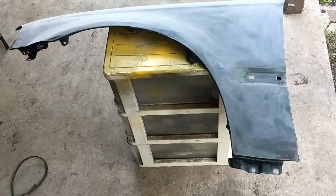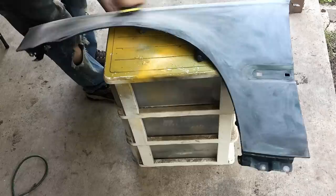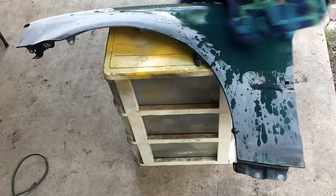You're gonna want one of these little foam blocks — they sell them at AutoZone really cheap. Put the sandpaper on it; that'll help you get into the curved areas because it's more flexible. After sanding, go ahead and sprinkle some of that wax and grease remover, let it soak in, and then wipe it down. Make sure to use a clean rag because you don't want a dirty one.